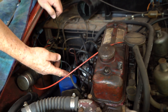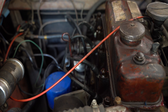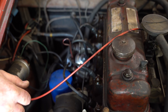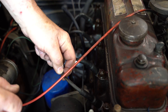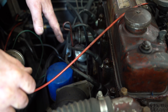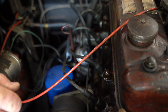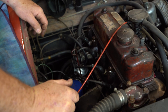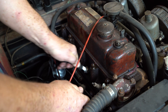The first thing to do is take the plug wires off. My suggestion is to mark these plug wires before you take them off, unless you know for sure where they go. Sometimes the plug wires aren't in standard formation — number one doesn't always exit the cap at one or two o'clock. It can be anywhere. If you rip all the wires off and don't know where they go back, it'll take you a while, because you've got 24 different spark plug wire combinations. Anyway, I know where these go, so we're going to take the spark plugs off.